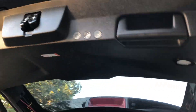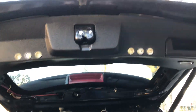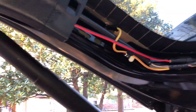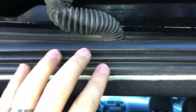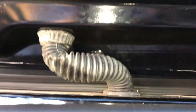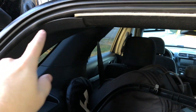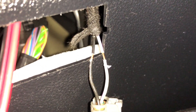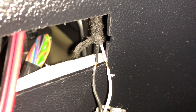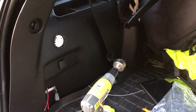There are the lights installed on the bottom there. I added a little extra on the back here for emergency use. I ran the wire up along here through this grommet — you just pull it out and pull up and you can access it through there. It's a pain, but get a metal coat hanger or something to strand it through and you'll be fine. Then I ran it inside and down. I'm powering off the wires down here — there's a white wire with a blue stripe or a white wire with a purple stripe that's your positive, and the black wire is your negative. I'm splicing right into that.